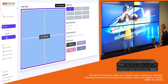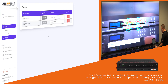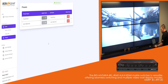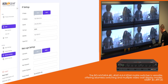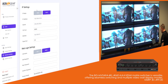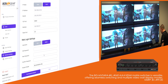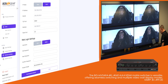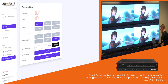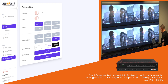You've also got your presets — I've already set up a preset for a video wall. Let's call the Fire Stick preset and boom, there you go. You also have your network settings, so if you want to adjust that you can do it right here. You can change it from DHCP — if you want to put in a static IP, you can. You can also change the login information right there.